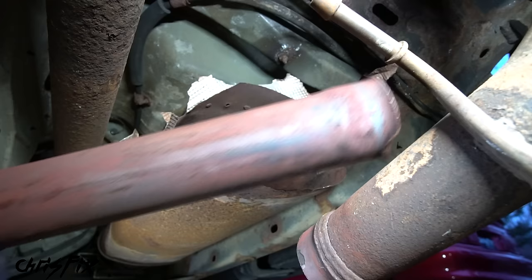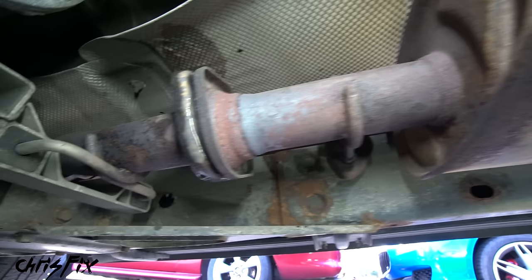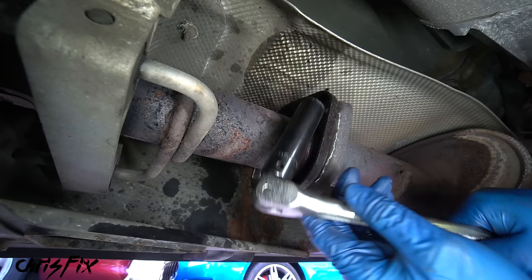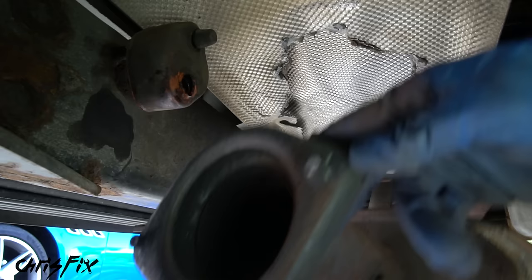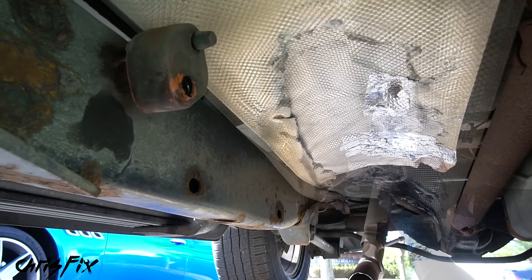That muffler definitely had to be replaced. With the rear end sawed off, we head to the front flange to remove the two nuts. After spraying with penetrating fluid, use the breaker bar — one stud snapped, but that's okay because the new muffler has its own studs, so snapping this isn't a big deal. The other side snapped too — it actually works in our favor and makes it quicker. Remove the muffler from the exhaust hanger using silicone spray as lubricant, wedge a flathead screwdriver in to open up the hole, pry outward and it comes right out. The heat shield has some holes so I'll use foil tape to cover them and reflect heat away from the cabin.